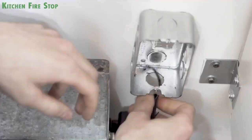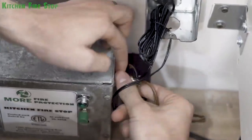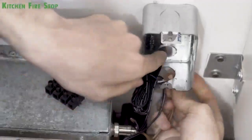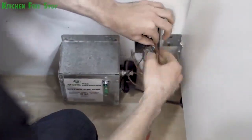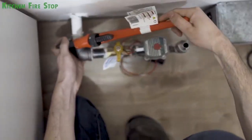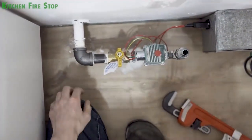The box goes here in the back bottom of the stove. There is one cable that goes all the way to the control panel on the top cover. This four wire cable supplies power to the control panel and receives control signal by the panel. Another wire is connected to the gas valve. This box is powered by the standard wall supply and it has a control plug on the other side that allows us to turn it on and off. It accommodates the 12 volt DC power supply and fits perfectly to the space at the bottom corner of the stove side.